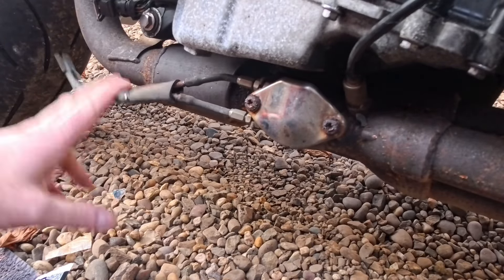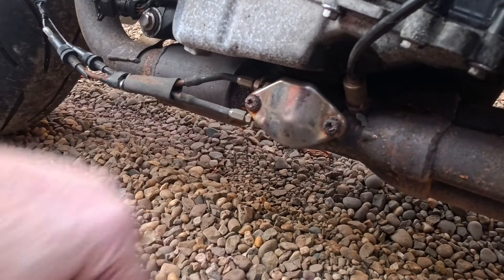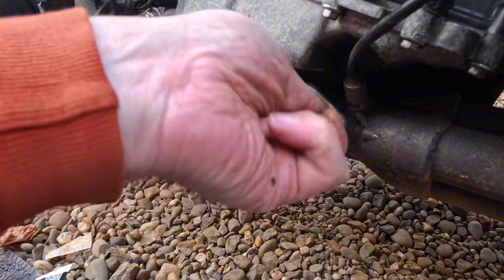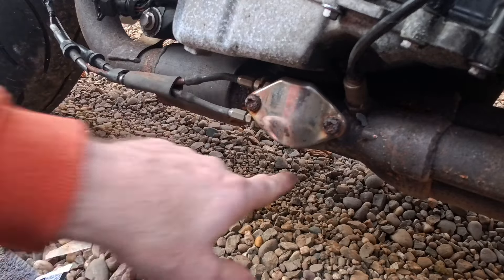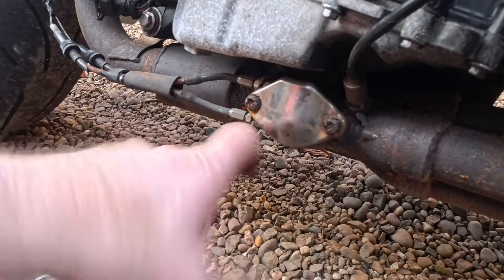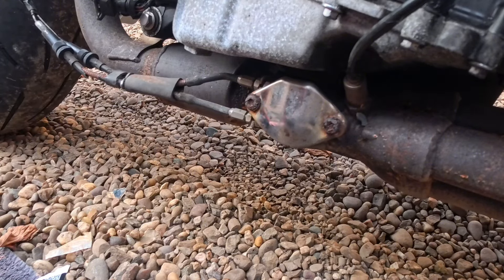With the servo motor off, the next thing we're going to do is attempt to get this little cover off, which I'd really like to put back on. What is the likelihood that they are going to come undone? Pretty slim I reckon. So we're going to put some heat on it and give them a clean up before we even try to undo them. I just want to get the cables off. I'm going to leave the physical valve inside the exhaust because in its resting position it's open. Let's give it a go guys.